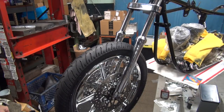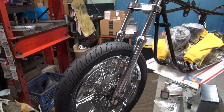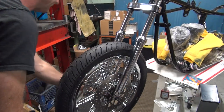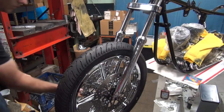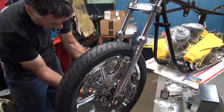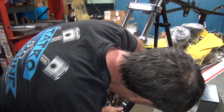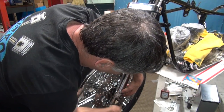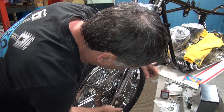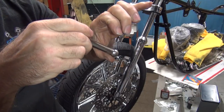Looks like the wheel's too far to the left. Also, wonderful. That'll be another problem. Those went down. I'm going to pull the axle caps down fairly even. I put my fingernail on the other side so I can tell when I'm getting close. Oh, this one's going to bottom out because it's the wrong size. Yeah, that centered it up when I did that because the axle has a big hole and the axle's small, so it drops down like this. That's what kicked it way over.